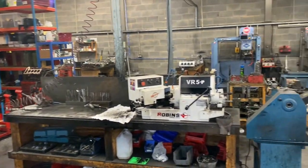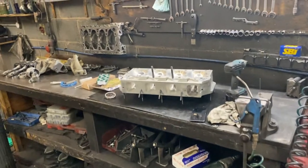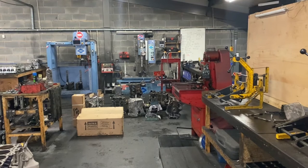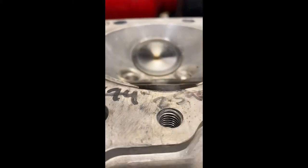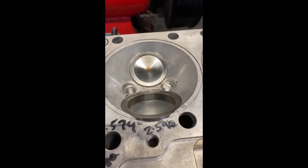It's seven o'clock and we've got a late night lock-in at Oldham Engines - I can't think of a better place to be locked into. We're finishing off this dragster head. We're going to get on the rotler and get the valve seats cut, and fingers crossed we will get on the boring machine and put the receiver ring in for the wire ring and the copper head gasket. As you will have seen, we've put the seats in - there's still a slight raised edge. They're a lot nicer but the customer's asked, so we're going to skim this part off so it's flush with the head, then into the rotler to cut the seat.